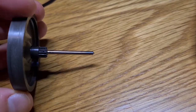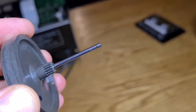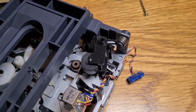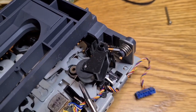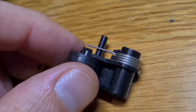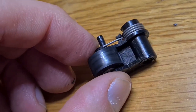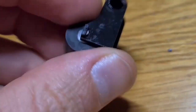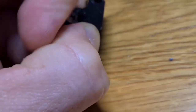This unit dates to the 9th of December 1998. On the edge of the capstan you can see years of gunk and tape residue - this capstan seems to be a plastic composite rather than metal, hasn't got as much weight to it. For the pinch roller, it's held with a little clip - once you pull the clip away from the arm it just lifts off all in one go. There we go - that is itching to be replaced. The pinch roller and axle are separate, so you need to retain the axle as new ones don't come with them.